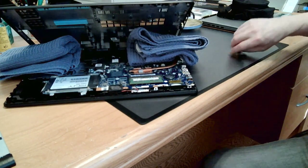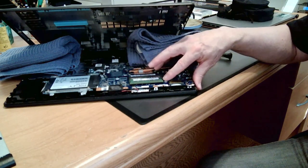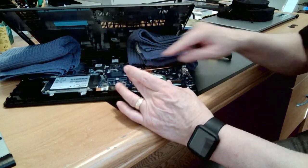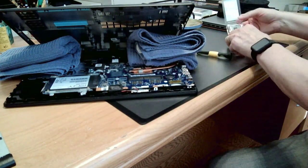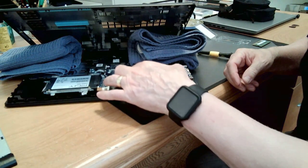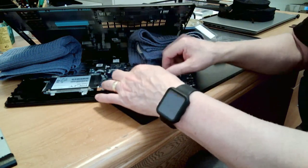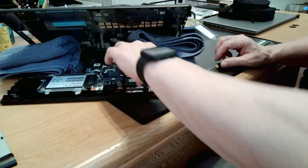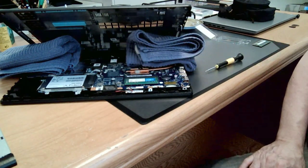There are two tiny silver prongs on either side of this RAM module, and basically what I'm going to do is just touch those and the RAM stick pops out. Then just pull it out, and make note of where the notch is. Here's the old RAM stick, and here is the new RAM stick. You've got to line up the notch right here, then just kind of wedge it in — make sure it's in there pretty well — and then we're just going to push it down and clip it into place. Just take your finger and, not real hard, make sure the thing is in there tight so it's got a good connection. That should do the trick.